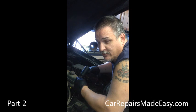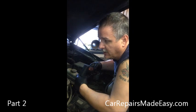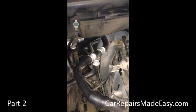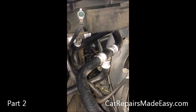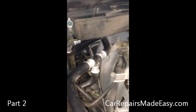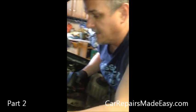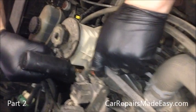We have the 2001 Ford Expedition tune-up with replacing spark plugs. On the other side it was pretty difficult on the two back ones to get a clear view with two sets of arms in there, but they're pretty much all the same. These ones on the driver's side will actually angle towards the front instead of the back like the other side. On this side we need to remove this bracket to get to the first one.